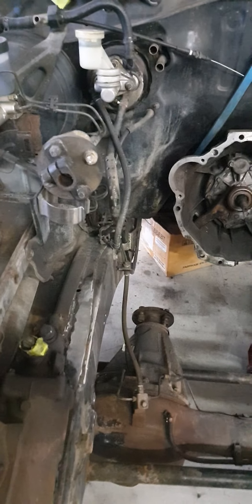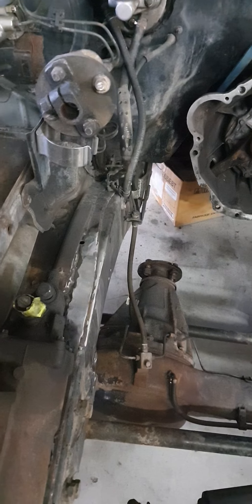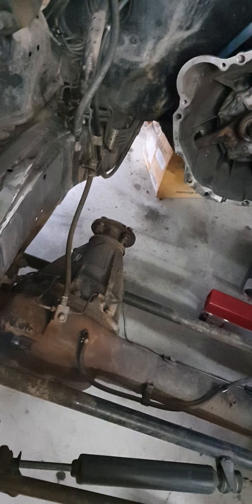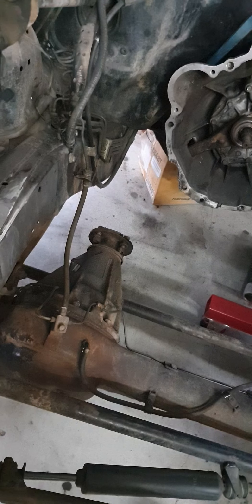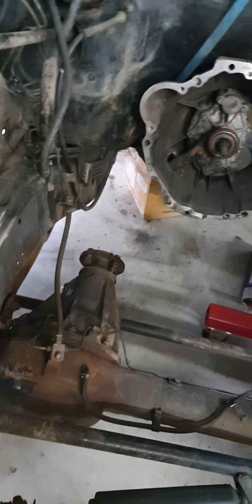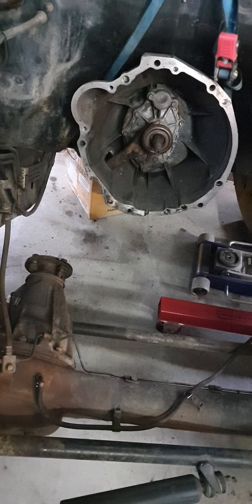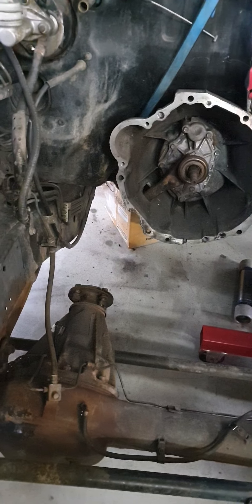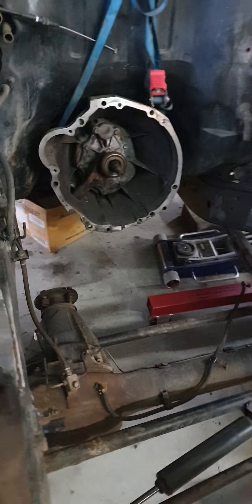It's all looking pretty good. This is going to be a good thing. It's still 2.2, 2.3 tonnes, so it's still pretty heavy. It's still got the wrong diff gears in it, so we'll do that after we get it registered. I think they're four-ones — we need like four-fours, four-fives, or four-sixes, something lower to let this little thing spin. I'm going to chuck everything I can at this to try and make it do a bit of torque. The owner's a 60-odd-year-old cranky pants, so he's not into racing it. It doesn't have to be a nine-second four-wheel drive.